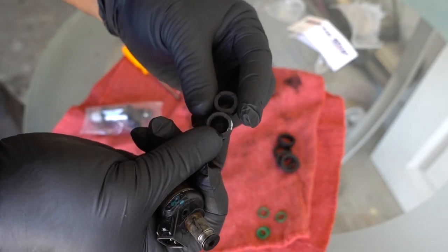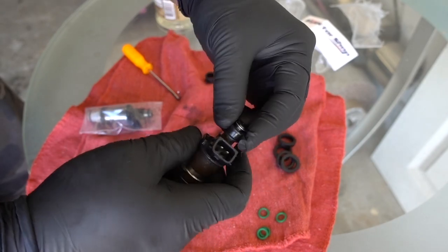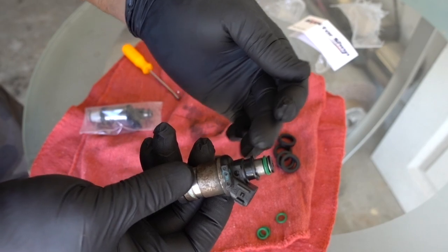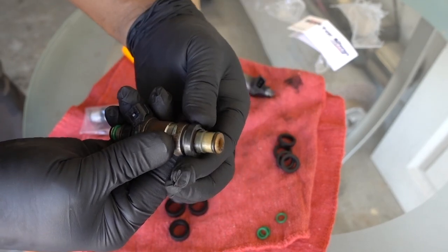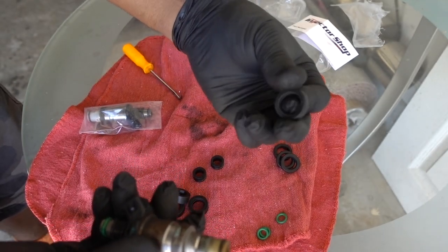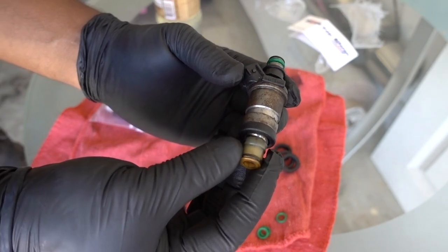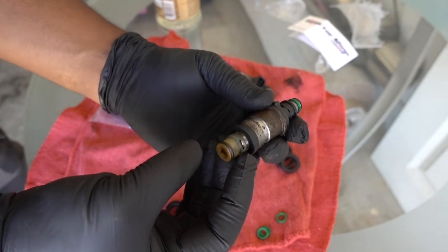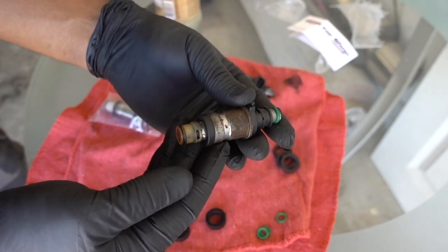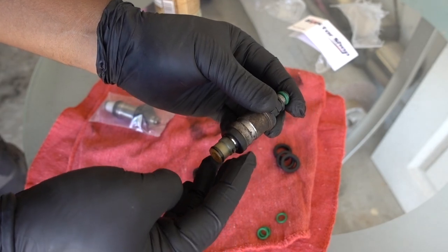Compare the new one and the old one. First you're going to put this one in place, then you can put the new green O-ring. So this part is being swapped. On the bottom, remove this one — it's out of the way. Grab the new one and put it in place. For this kit we don't have this one new, but when you put the injector it is going to seal with this one too. Hopefully we don't have any leaks — if we do I'm going to have to run to the store and replace this one. As long as we have the one on top that goes to the rail and all the other ones new, we should be fine.